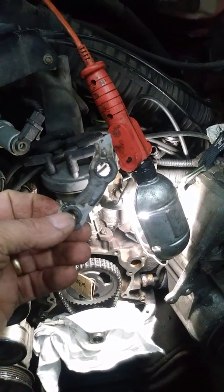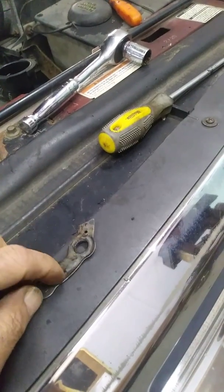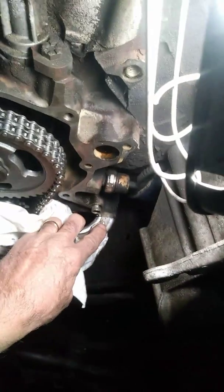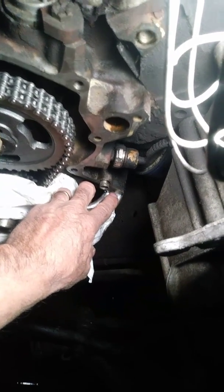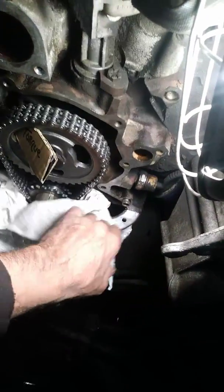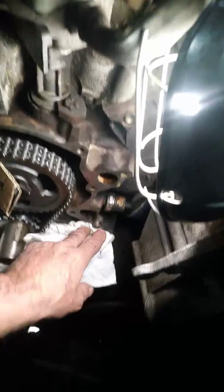I was going to touch on this gasket issue. These were parts of the original metal oil pan gasket and they have a rubber fused to them. I tried to slip some silicone under and around them but realized it just wasn't going to work. So I took a Dremel tool with a little tiny cutoff blade and carefully cut these pieces right off of there - being careful not to go too deep. I've got the cork repair pieces that are going to go in their place, and I'm just going to silicone it real good since I'm going to do an oil pan gasket soon anyway.